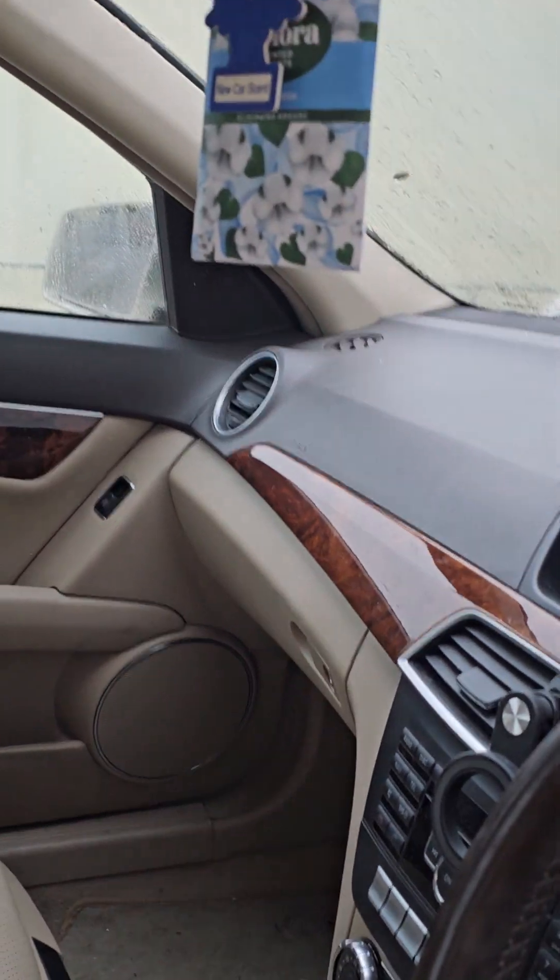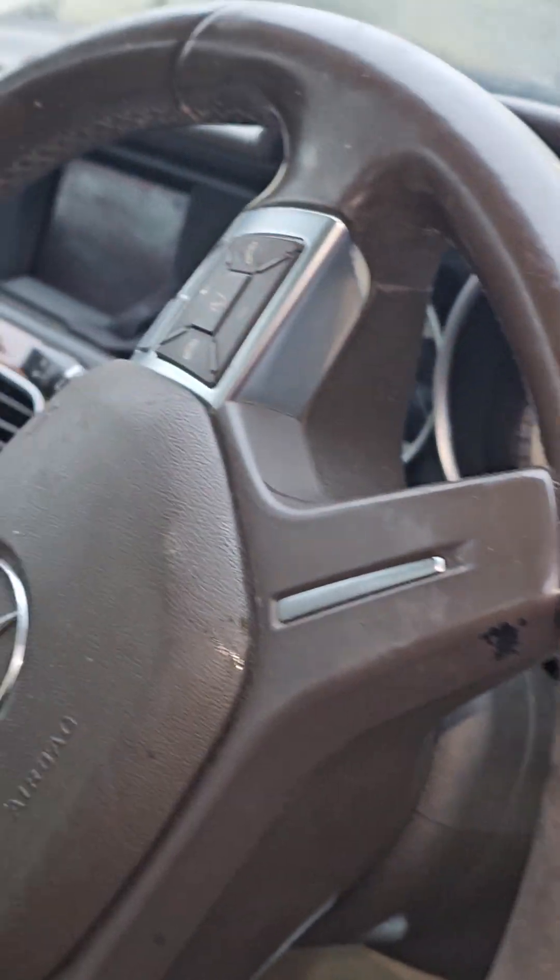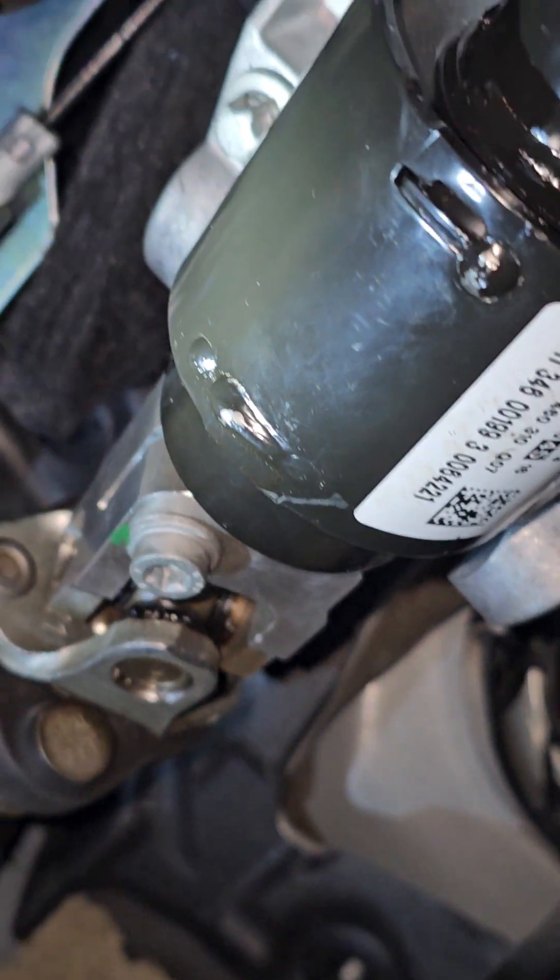Basically, if you're fairly agile and slim, all you need to do is take the undercover off the car underneath with the three screws. Now if you look at the dashboard first on mine — mine's a W204 2.1 diesel — underneath you've got the two star bolts, which are mentioned in all the other videos. There's one there, one there. Then there's two bolts up underneath.